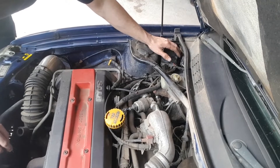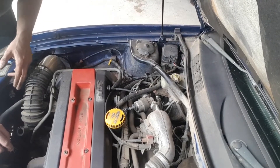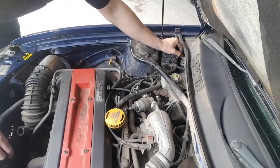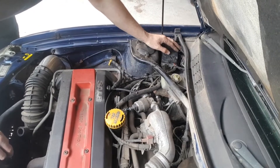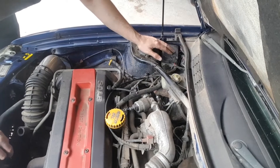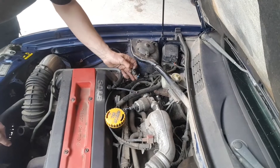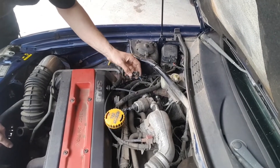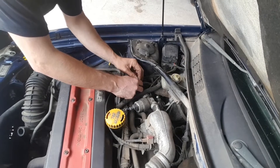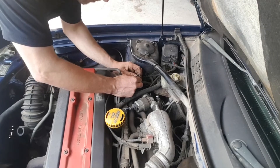Basically you can cut the plug off, solder nice wires in down to a 2-pin, straight to the APC. Job done. A lot of people go to pin 60, but for me it seems a lot more faff, really — not when you've got the wires already in the bay ready to go. So that's as simple as that. This pink wire with black trace — the EVAP — doesn't get used. So again, what I do is cut it off, end the tail, and then just tape it back up neatly inside the loom. Job done.